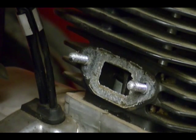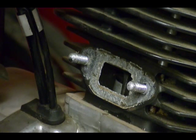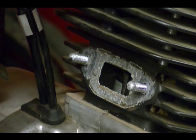The question was: how are you able to pressurize the crankcase and cylinder through the intake port when the piston is covering the port at bottom dead center? The answer is that the piston does not create an airtight seal between itself and the cylinder, so any pressure I create in the intake port is just going to go right past the piston and into the engine. The piston does act like a valve — covering the intake, exhaust, and transfer ports at the right time so the engine runs correctly — but it does not create an airtight seal with the cylinder.